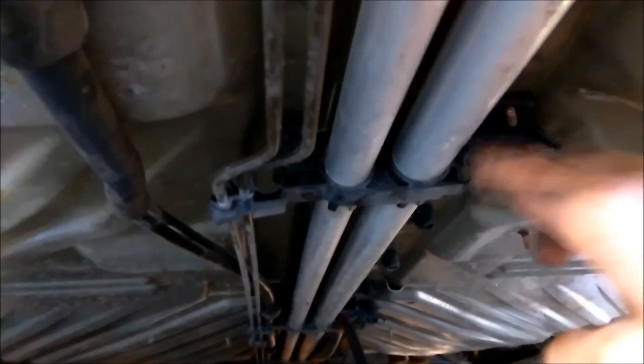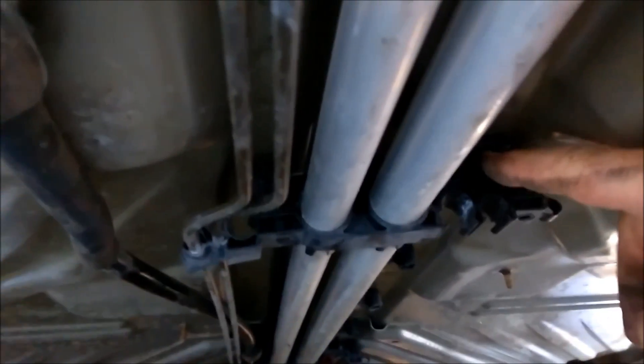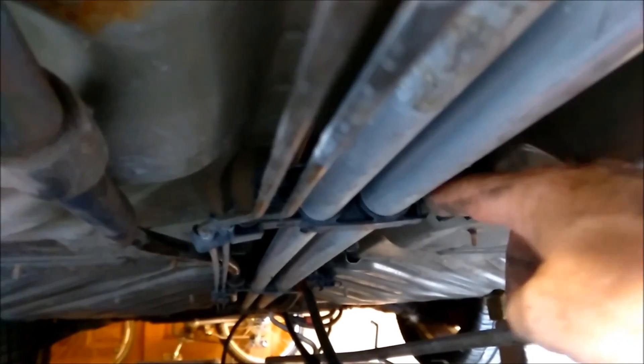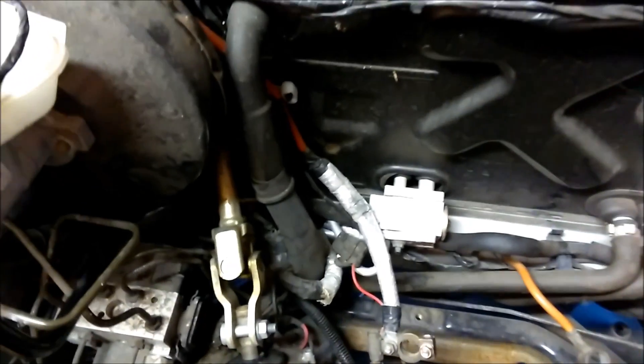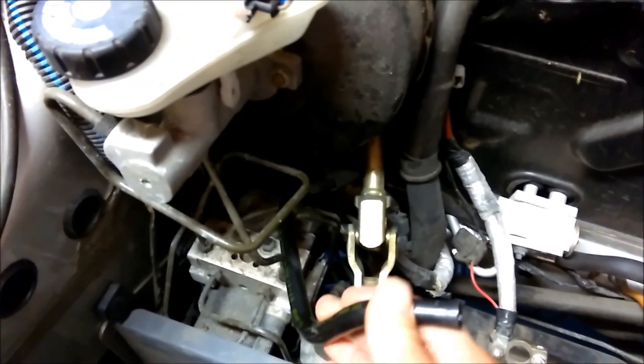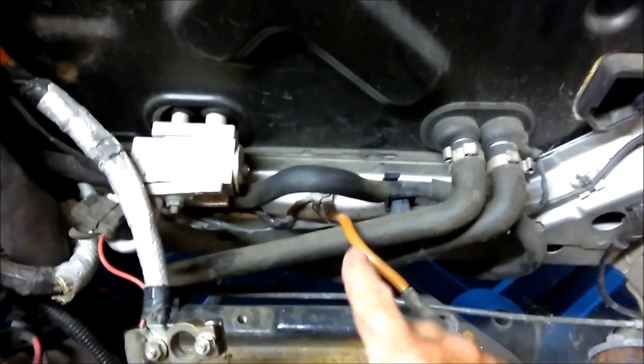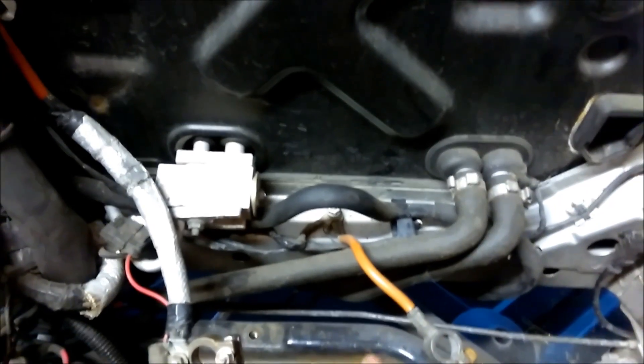These brackets need to drop away to give space to do that, and there are three of these under the car — just some simple two screws holding them on. Then the floor pan will be ready to go back on, because having a straight tube in here means I can easily feed cables without taking the floor pan off. I was going to use the old vacuum tube to feed cables through, but it goes through all sorts of wiggly, tortuous lines which makes it almost impossible. So I'm just going to take this out and replace it with a rigid tube.